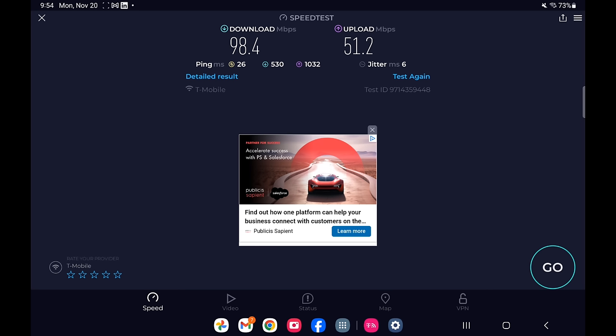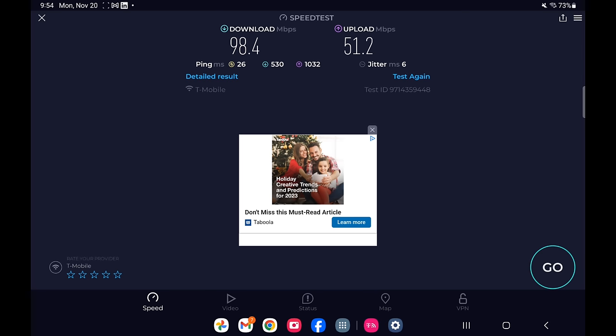And I've seen that change be even more drastic in the past. There's been times my N41 would maybe be single digit for upload, and then my N71 in those cases would still be high. So I might still have like a 50 on the N71, but just like 4 or 5 upload on N41. So this does have the potential to help a lot of people under certain situations. This isn't a setup I would recommend for everyone. Again, this is really for folks that are seeing an issue with N41, especially on upload of N41. This allows you to take advantage of N71 that's out there.